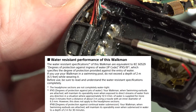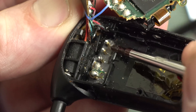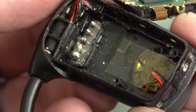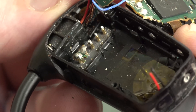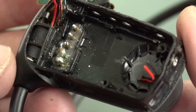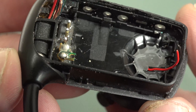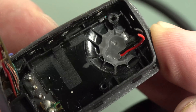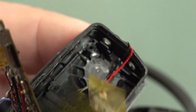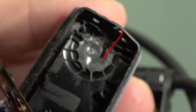It's interesting that they decided to solder those on there. Because when you solder them onto the PCB, someone's gonna hand solder that - that's just gonna heat up your potting. Whether or not that would cause an issue, I don't know. I find that an interesting choice. Off the bat I wouldn't have chosen that - I would have had some sort of pogo pin arrangement pushing against the board. But it's not going to be as robust, so it's all a trade-off. I'm sure they knew what they were doing after many design review meetings.